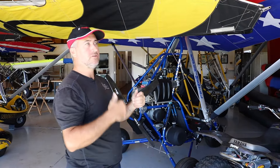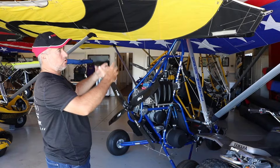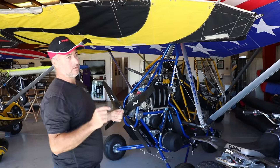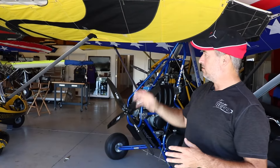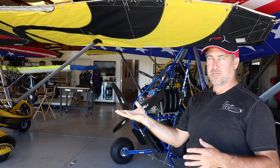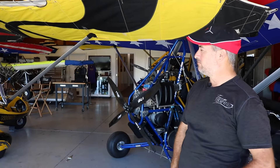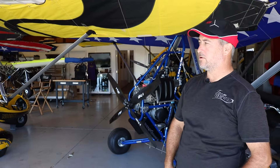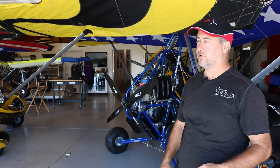This is over a 6061 aluminum frame, and these wings — including the little ultralight wing — are all rated to six G's ultimate. On our machine with an 1,160-pound gross, that was tested inverted with 7,000 pounds of sandbags — the equivalent of parking two regular-size cars, one on each wing. So they're very, very robust. In the history of triking, you're not going to find any types of structural failures in the wings. They're really, really well built.